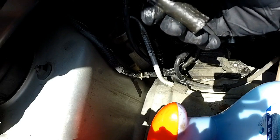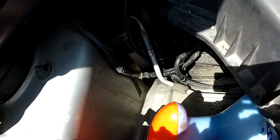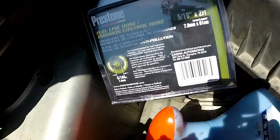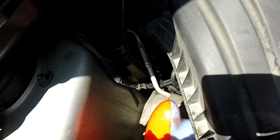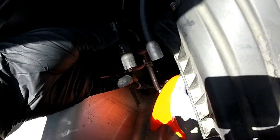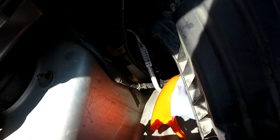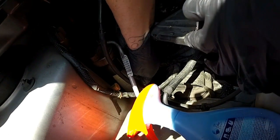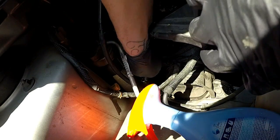Make sure that you get some fuel EVAP hose — it's got to be EVAP-rated to be smog legal. I wasn't sure if it was a 5/16" like this one. I've got a 5/16" and a 3/8" — 5/16" is going to be the right hose. I'm just going to match up the two lengths, cut it right there, now I've got two same lengths. Let's go ahead and put it on.